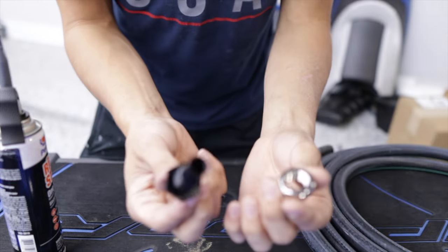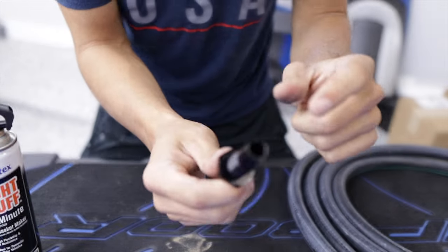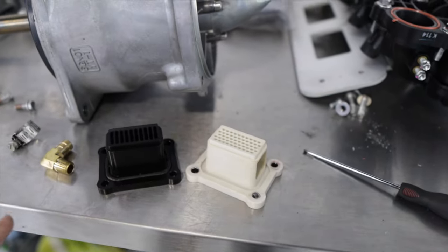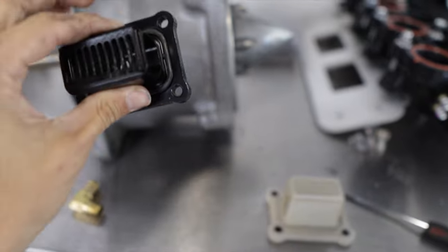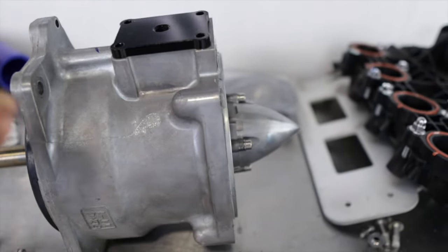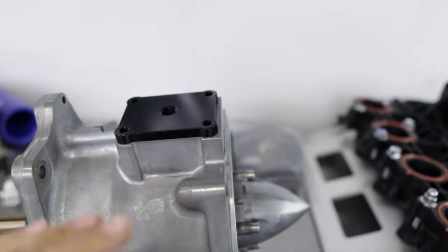After you get the hole drilled, this is the fitting you'll want to install. Before you install it, you'll want to put some Permatex 'The Right Stuff' gasket maker on the surface that'll be on the pump side and on the surface that's going to be on the inside of the hole — thread it on to make sure you have a watertight seal. After installing that fitting in the pump tunnel, we're going to move over to the pump itself. We will be removing this plastic strainer and replacing it with this billet piece — transfer the rubber gasket onto the new piece, fit it in, use the factory hardware to tighten it back up with blue Loctite on all those bolts, then add this fitting using thread sealant and thread it in with the fitting pointing straight up. Then we can put this back in the ski and finish the cooling kit.